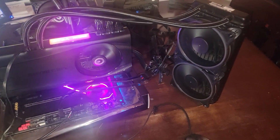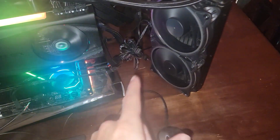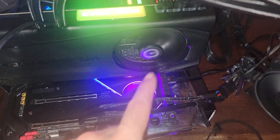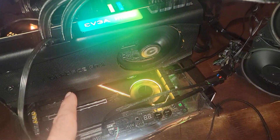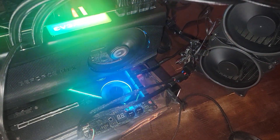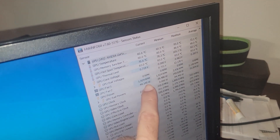I've got it set up on the bench. Both fans are split to a Y connector, but they could also be plugged directly into the cable that comes out of the GPU, which is a splitter — so the pump could control the two fans. However, in changing around and using the secondary splitter, I found out those fans are getting power from the motherboard instead of the splitter. If I plug into the splitter, those fans don't work — and that tells you something: the pump is not working.